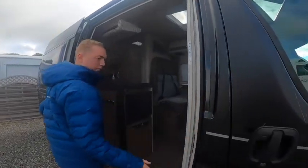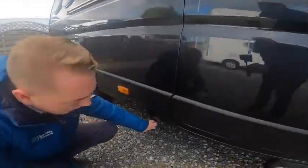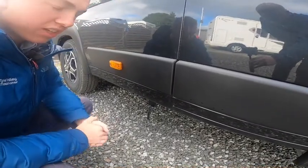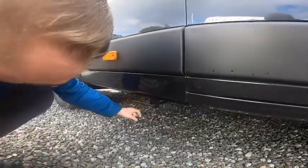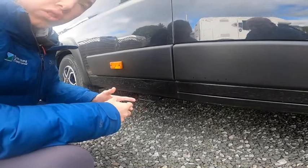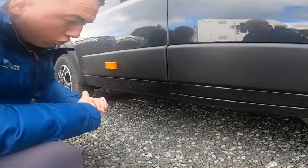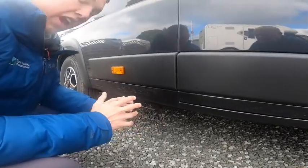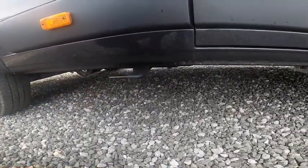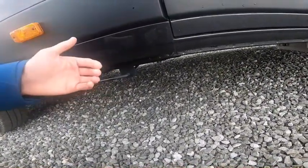This black handle is your wastewater release handle. Anything you've drained off via a plug hole goes into a separate holding tank. Normally on the way out of your site you'd pull over a grid, turn it and release your wastewater, which comes out in the centre of the tank. Make sure you fully drain this off in winter so water doesn't freeze and cause damage. Also, carrying wastewater impacts your payload, so drain it on the way out to improve fuel economy.